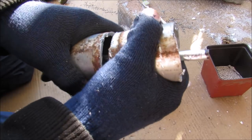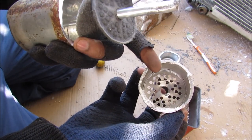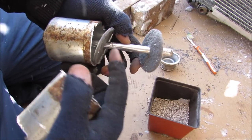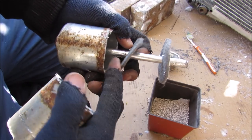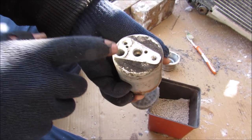Now I've got all the desiccant out. I'm going to continue and remove this canister from the straw. Now that we've got this all apart we can see just what's inside. At the top here we have this grate like material and that's followed by this felt like filter material. Then we have this empty space where the desiccant used to be. Then again we have another felt like material. And down at the top there we have another grate where the top of the dryer is where the refrigerant enters.